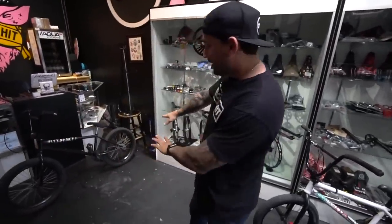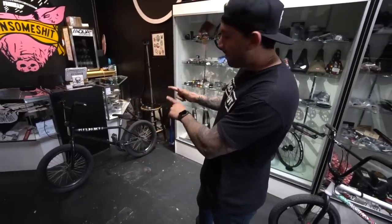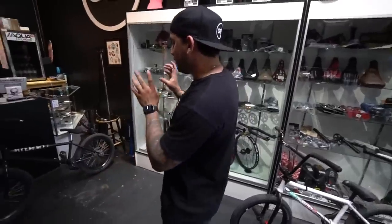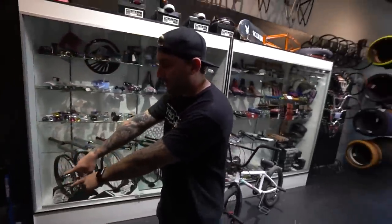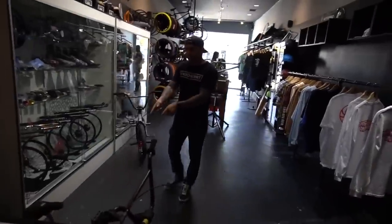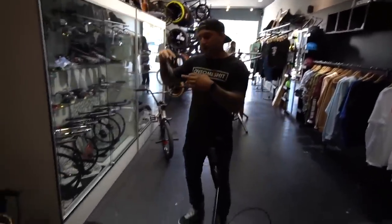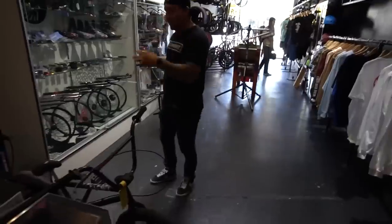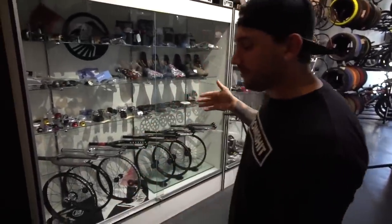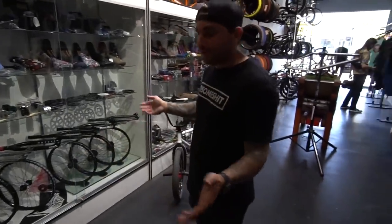Nate and I had to figure this out — that's why that bike is already taken apart. The simplest way is to remove the victim's back wheel, because back wheels are always more work. You have to take off the chain and all that other good stuff. So we're taking off Chris Long's back wheel. Then we're taking off my front wheel, putting the front wheel on the rear triangle. Basically you put the forks on your front wheel and then you put the dropouts of that bike on the forks. It's going to be easier when I show you. Then you tighten it down with your 17mm socket and then you're ready to go. Let's get to it.